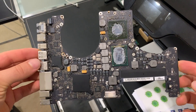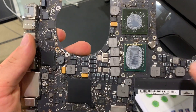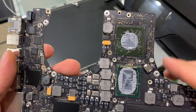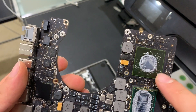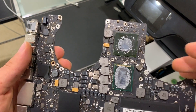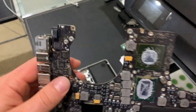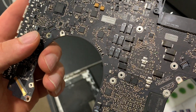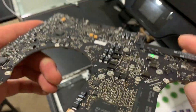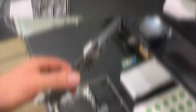There you have it — the logic board for a 2011 MacBook Pro i7 dual core. It's usually these two chips that mess up. I believe it's this one that's the actual one that fails. The last time I sent this out, they upgraded this chip to a newer one because the chip gets cooked and the internal part actually fails. These are the two graphics card chips, and it's usually one of them that goes. You can see some solder marks from where they did their modification. They're going to take this, redo it, and when it comes back I'll show you the difference, and we'll put it back in.